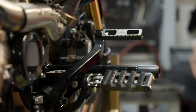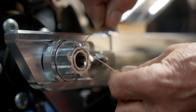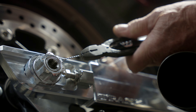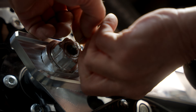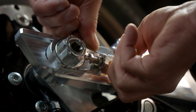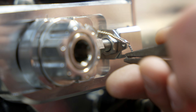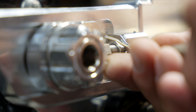We're going to put the safety wire on the rear axle nuts. Get your safety wire and pliers, thread the safety wire through the nut — you want to pull on the nut in the direction that it would be tightening. Do a quick measurement and clamp the pliers where the receiving end of the tab is going to be so that when you twist it up you have the proper length. Fix that wire through the tab, repeat the process of twisting the wire, trim it off. You want to turn it inwards so it's not going to catch your pant leg or a cleaning cloth. Do the same thing on the other side.